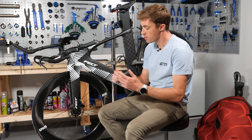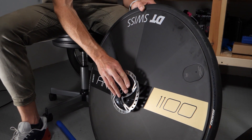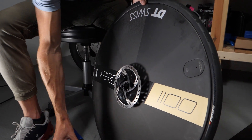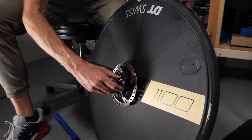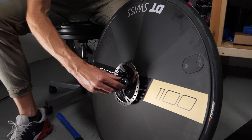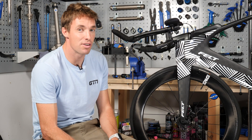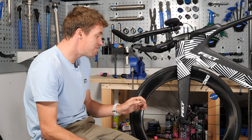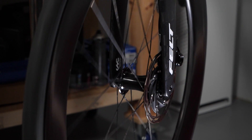When you get to your destination, you've hopefully prevented any hassle with your disc brakes by packing your bike well. Simply reinstall the disc rotors on the wheel, remove those spacers, pop the wheel in and you should be good to go. But this is the real world, so your brakes might be rubbing a little bit, making that awful scratching, squeaking noise. No one needs that kind of aggravation — even if the noise is not costing you a single watt, it's very frustrating. But before you take a hammer or a wrench to that very obvious kink you can see in your disc rotor, try loosening off the brakes a bit.